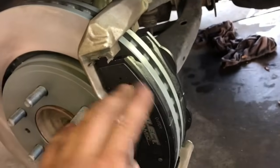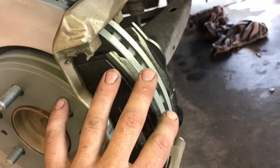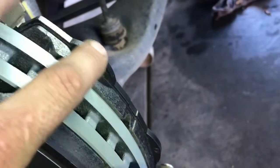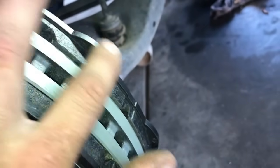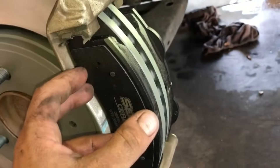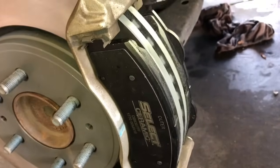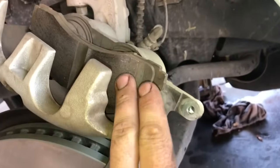Now, one quick note — a lot of people can actually mess this up pretty easily. These pads come in a set, meaning there's a front pad and a rear pad. As you can see, the rear pad has these little flanges on it — those are just to make room for the caliper pistons. The front pad does not have them. You can actually damage your rim and your caliper if you install those backwards. Even though the caliper will mount on and you can bolt it on, it will be a little bit cockeyed, so just take special note of that.